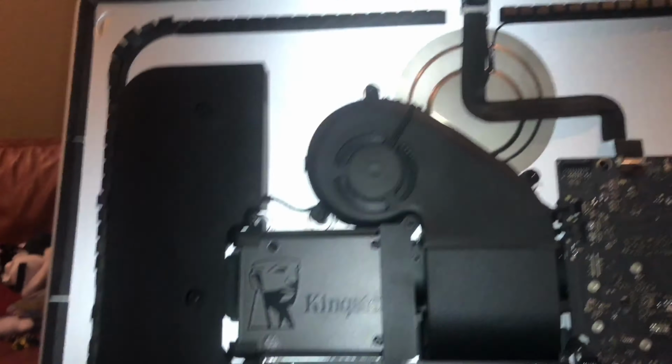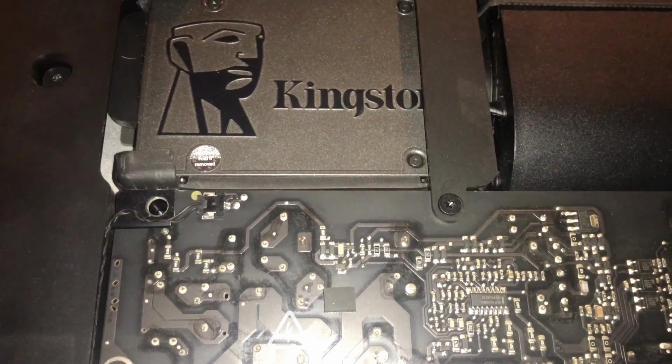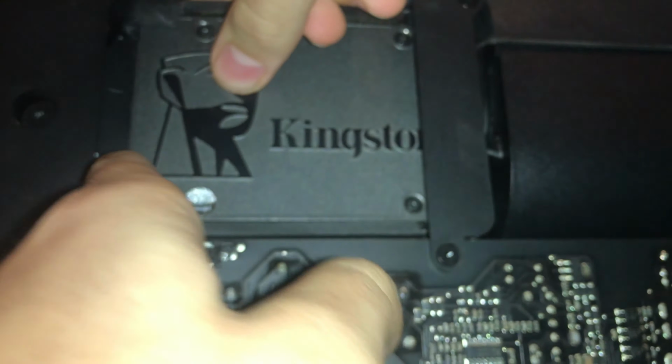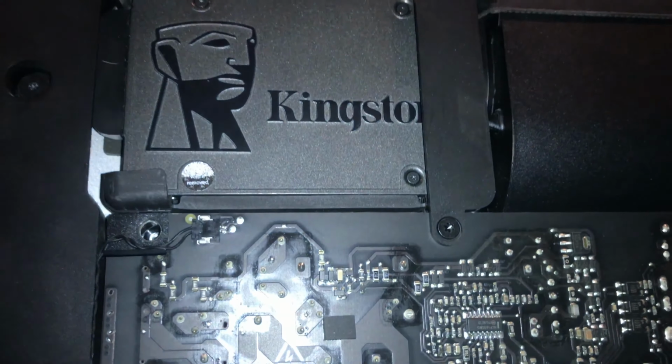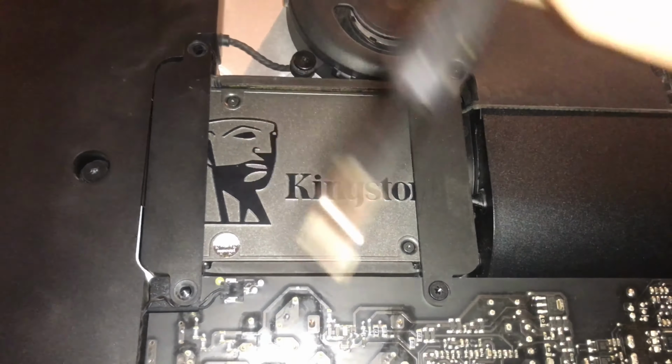But basically, there I just disconnect the screen and then clean everything once again, and then the screen went black. Yeah, basically there I'm just disconnecting the screen. After all that, I just turn on the flash and double check every connector. I actually took off one bracket. There's the screen, one bracket of the SSD just in case, and dusted off the screen connectors with the brush. There I'm trying to reconnect the screen, the SSD. So yeah, basically after all that, it finally turned on. You'll see.